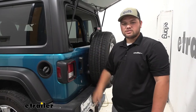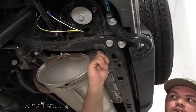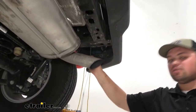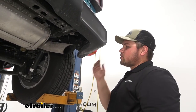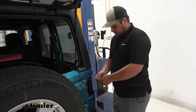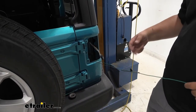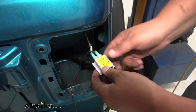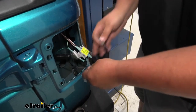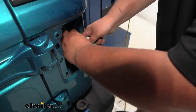We can now run our wiring over to our passenger side. I took our brown wire back around here and through this hole in our frame rail, then out through the hole on this side of the frame rail. It comes out right up here. I pulled it into this rear cross tube and across the back of our Jeep, then out this hole here. I'll lower the Jeep down, take the taillight out on the passenger side, drop our airline tube down, and pull that wiring right back up to our taillight. I went ahead and tested the wiring on our passenger side — our green wire is going to be our brake and turn signal, and our white and orange wire is going to be our running light signal. We'll pull our wiring back up just like we did on the driver's side. We have our two wires coming in and our wire going out to our taillight. I went ahead and connected our taillight signal here, then spliced in our brown wire to our spade connector. On this side we'll only have one brown wire, so we can go ahead and connect it here.